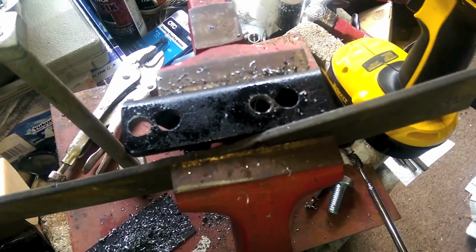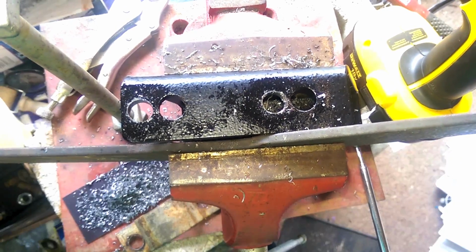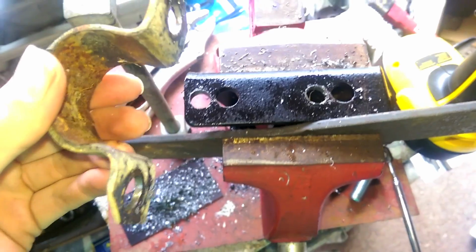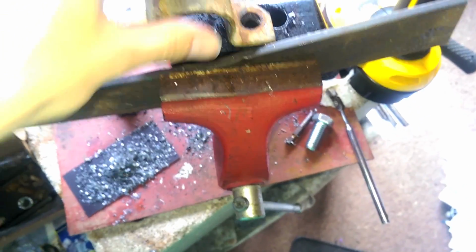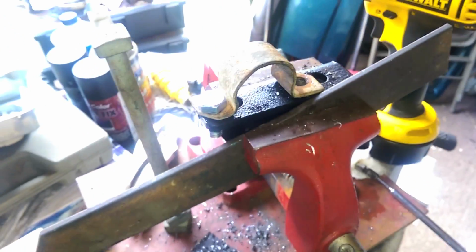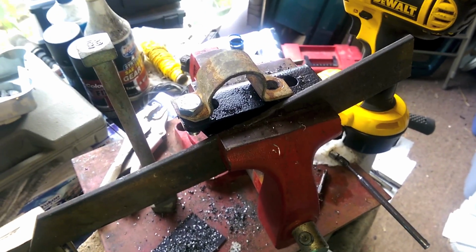Okay, so working our way up to a 1/2 inch bit, this is what we finally get. And don't forget that you got to drill these guys out, because these are slightly smaller than the 1/2 inch bolts as well. So now it moves us over just a little bit. Cool. Alright, let's do the same thing to the other one. Let's see if this monster fits.